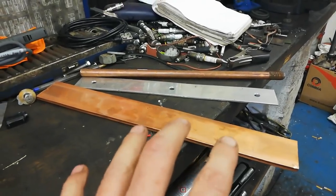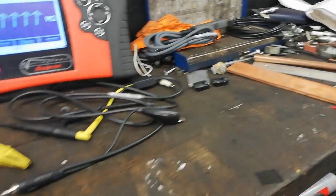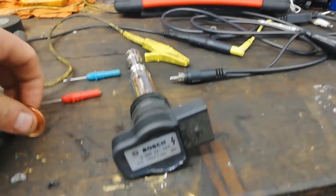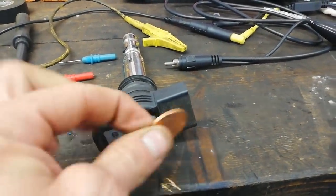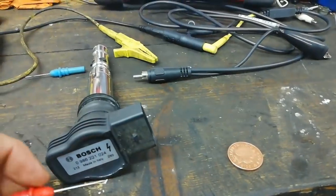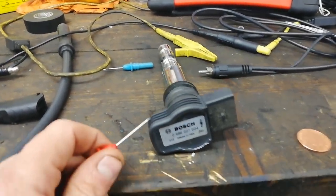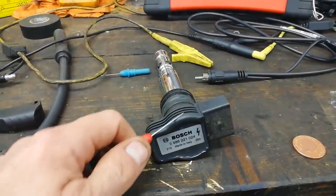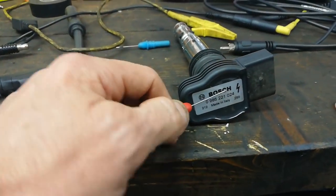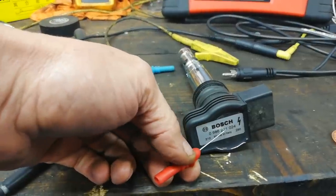But in the real world, when we're trying to find a faulty coil pack and doing secondary ignition pickup, if we're suspecting one of the coil packs is faulty, that could cause us difficulty. An old school test is you put a penny onto the top of the coil pack and use that as a pickup with your back probe. But if you have a coil pack that has indeed failed, there's a possibility of discharge into the top surface, effectively connecting the scope to thousands of volts. That's how you smoke your scope.